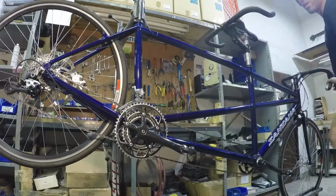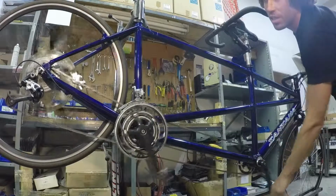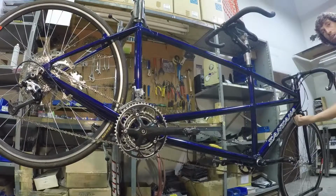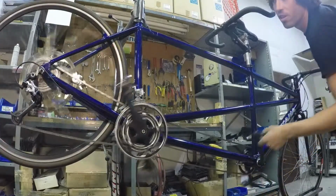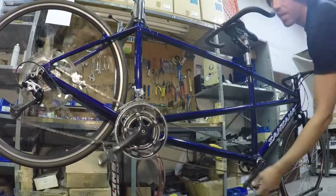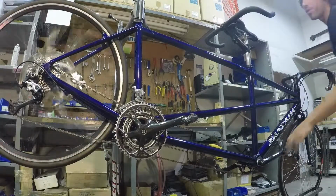Now moving to the rear derailleur, you'll slowly start shifting up the cog set. If it hesitates to make one of those downshifts, go to this barrel adjuster under the down tube in the middle. Unscrewing the barrel adjuster one click at a time, and then going back and trying to make those downshifts. Unscrewing the barrel adjuster helps it do downshifts. Going back and doing upshifts, if they hesitate, you'll screw the barrel adjuster in to help it do the upshift.